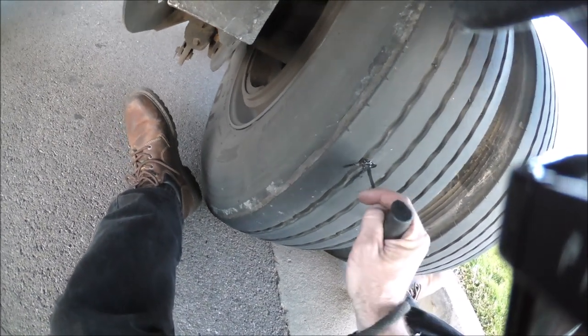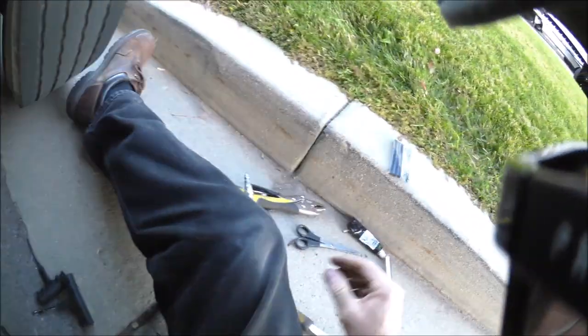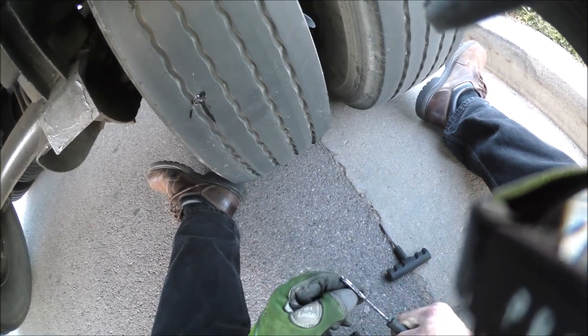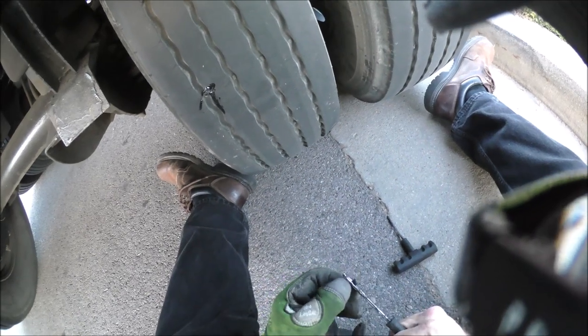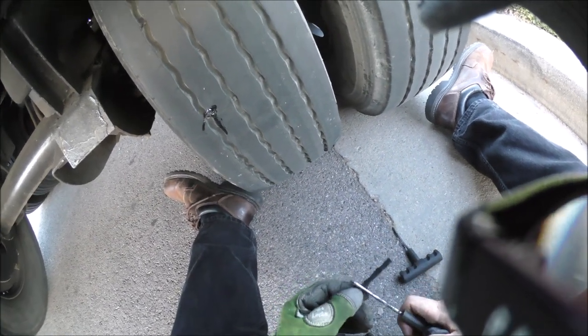Sometimes you can go around it and get another one in. With truck tires you want to put another one in and space it out. In cars the pressure is 44 pounds. With bias it used to be 34 or 33, but all radials are pretty well 44. If anybody says something different, just read it on the side of the tire - the tire will tell you the pressure it needs.